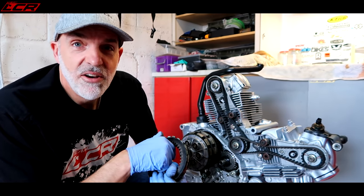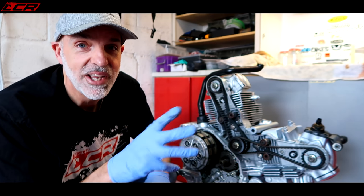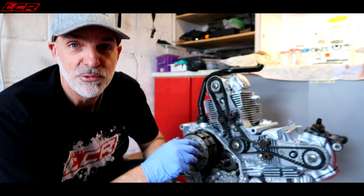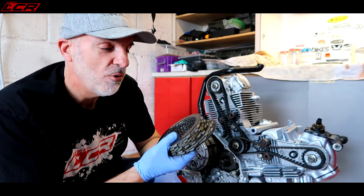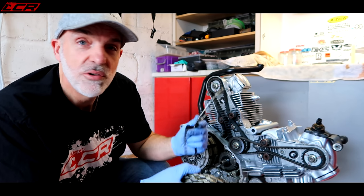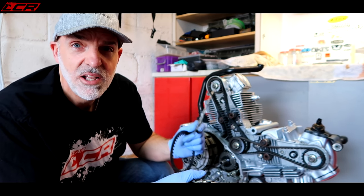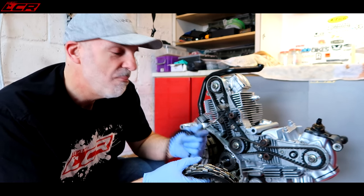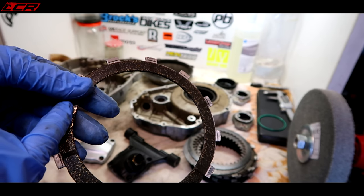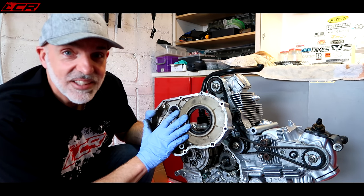We're getting a little bit serious now. The casings are off, it's all getting a little bit technical. I've also got to take some of the casings apart and remove all of the seals for the Cerakote - you can't have anything left on them, they've got to be absolutely bare. While I was in it, I thought the clutch plates looked a little bit low. According to the manual they should be a minimum of 2.6 millimetres. Well, mine are about 2.8 something, so they're within serviceable life. I don't know how much meat you get on them new - they don't look like they've got too much. I may replace them and get a new clutch kit while I'm in here. Makes sense, doesn't it?